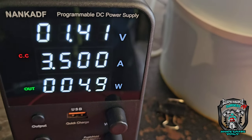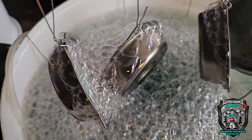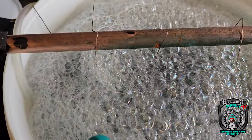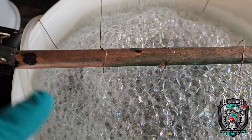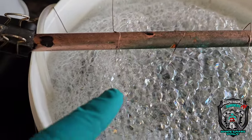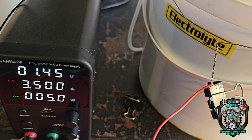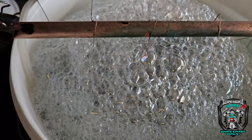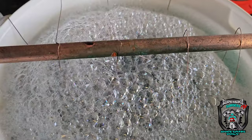So I don't want to go down a massive rabbit hole with this, but various parts getting a zinc plate or a zinc nickel plate. These are nearly ready to come out. Carburettor tops, all the little brackets, various little bits and pieces, all zinc plated. They're going to get some gold passivate and then left to dry for 24 hours. Electroplating, really interesting subject, and you could talk about it forever. You can do it at home, definitely, it's a DIY thing. It's a little bit involved, quite messy. If you've only got four carb tops to do, then you probably wouldn't bother getting involved, really. It can be a bit of a faff.